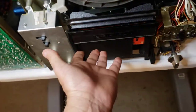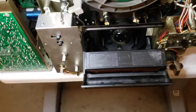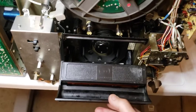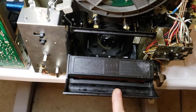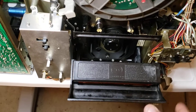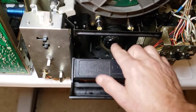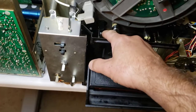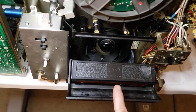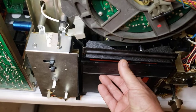You just basically push it in and pull it out — that's how you actually load a CartriVision. If they're really out of alignment, you will not be able to get them to load, guaranteed. These doors are a real pain in the ass. If they're not aligned, and if the spindles on the lower part of the door are not fixed — like this one was off its track and jammed because people were trying to open it without the loading pins in the correct position, which should be below in the loading position. They were in the up position, so somebody forced the door. I had to go in and fix it, replace the rubber bushings, and get the alignment fixed. Now it loads the cassette correctly.